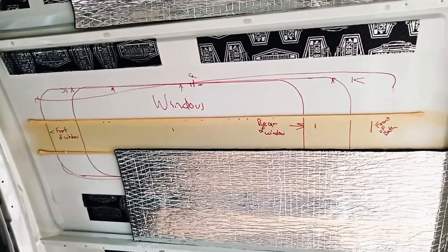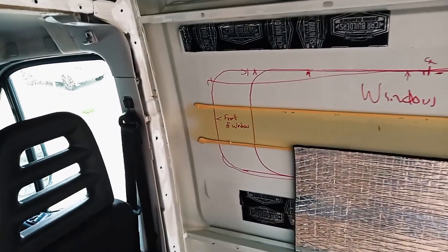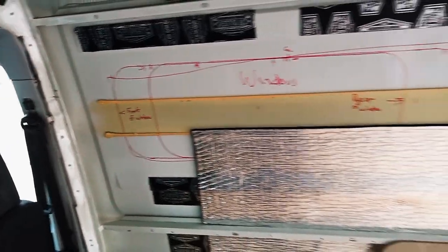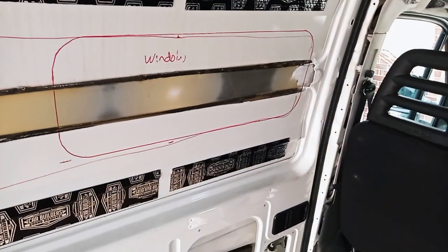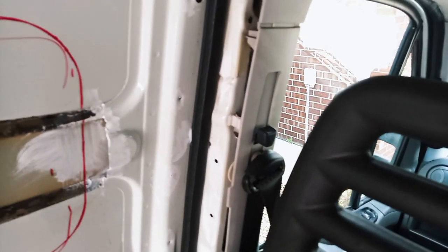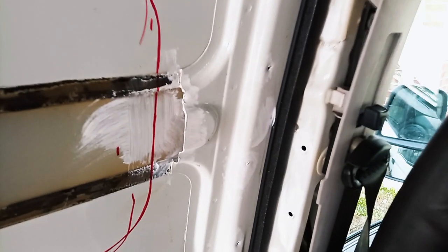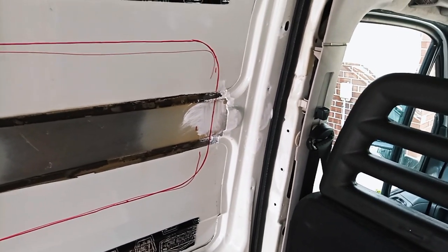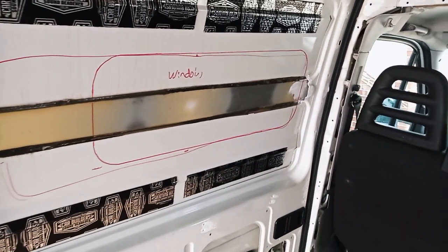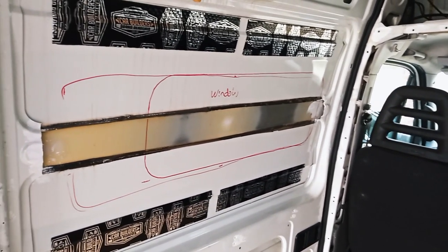This morning I'm going to cut out the next two. In this space where the window behind the driver's seat is going, I've moved the window forward because the bathroom wall will end up coming here. For the window in the sliding door, it's quite close down this side to the steel that I've cut out, so I may not be able to cut that from the inside. I've shifted that one quite far forward too, even though it possibly might look better if it was centred in this space. Let me show you on the outside why I've decided to do that.